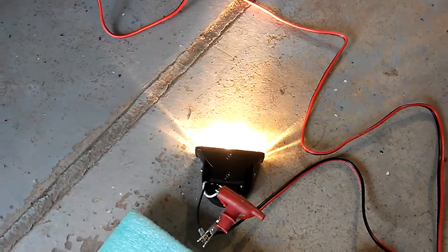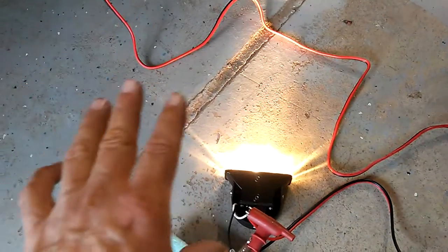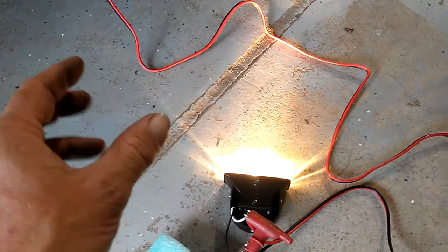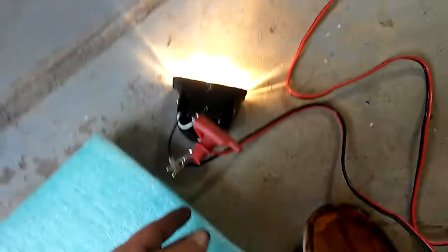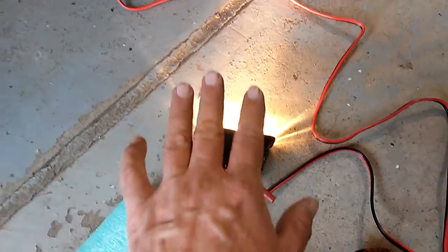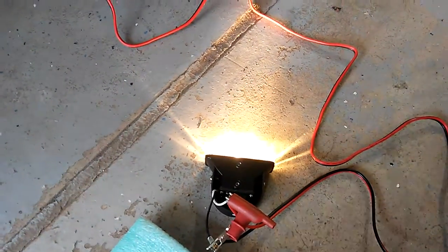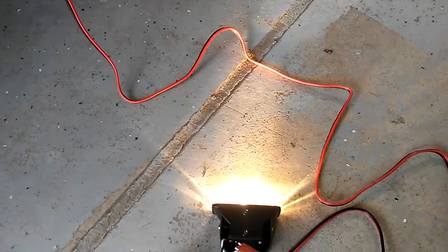I can leave it in a short mode without worrying about burning up the car, so this is perfect. I have the wires coming out of the dash, I've intercepted and disconnected the wire, and what I'm doing is using this light as a load. This is a 55-watt bulb, and obviously the circuitry on the parking light circuit can handle that because each bulb was about 23 watts.